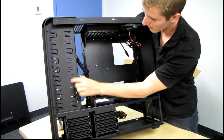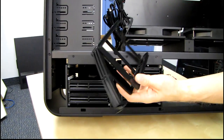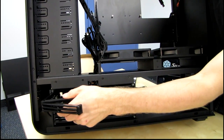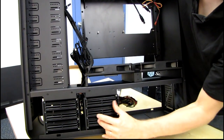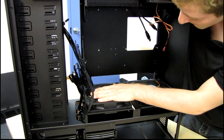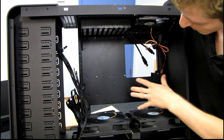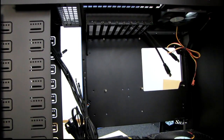Looking at the internal features: here we can install all our five-and-a-quarter-inch devices, and here are the hot-swappable three-and-a-half-inch bays. It looks like you can probably screw SSDs natively onto these trays, which makes me wonder why SSD adapters were even included — maybe for trays that don't have that piece. The large AP181 fans blow upward at your components, with video cards installed lengthwise. The motherboard tray supports up to XLATX, for longer boards like the G1 Assassin.